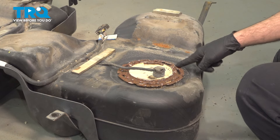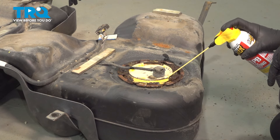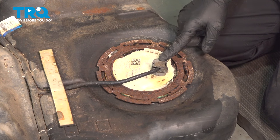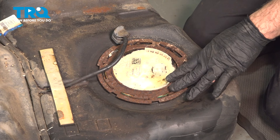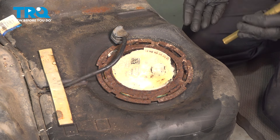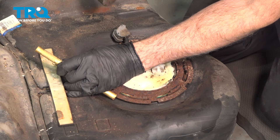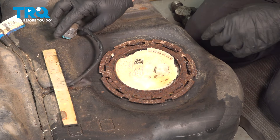Once we have this cleared off, spray with some rust penetrant to help loosen things up. If your lock ring looks like it's in rough shape, consider sourcing a new one before reassembling. Disconnect our electrical connector by pressing in on the little tab and lifting up. To remove our lock ring, we're going to use a brass punch — the reason we're using a brass punch and not a screwdriver is because we're exposed to fuel vapors and we don't want to cause any sparks. Brass will not cause a spark. Practice safety around fuel. Before popping this up, clear off any debris sitting around it — we don't want any garbage to fall down the side of the tank.